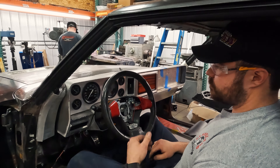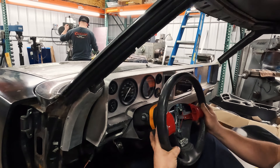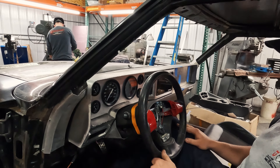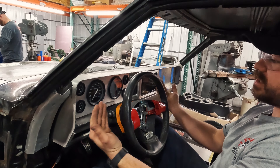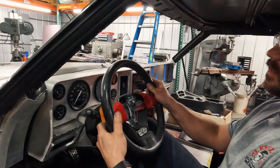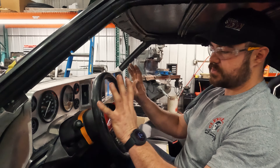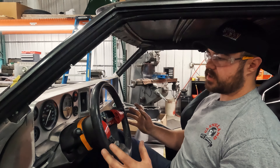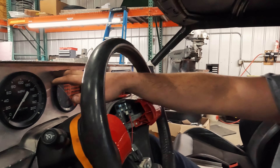As we start rolling through components — that isn't an old-school steering column. It's actually a C6 Corvette column. The reason we use that is it's power telescoping, so it comes in and out roughly about an inch and a half total travel, and it's also tilting. The customer wanted a flat-bottom steering wheel and modern wheel, so we're just using this one as mockup right now, but he wanted that modern column look and feel.